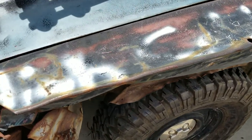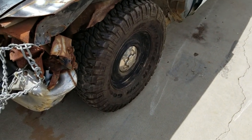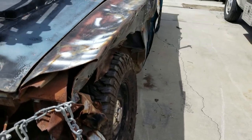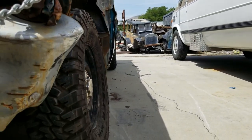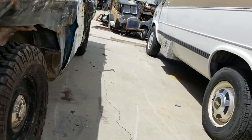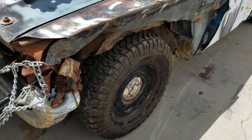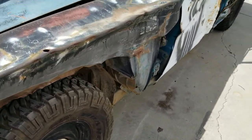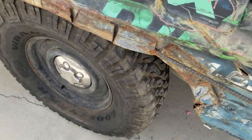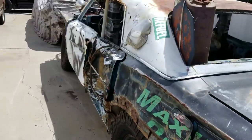I'm not gonna adjust the toe to compensate for their stupidity. I'm gonna have to cut or grind the welds and just recamber the front end so the wheels are actually level. You can see how bad they're cambered — this is stupid. If it were taller and I could get more up-travel to where they'd straighten out, I wouldn't mind a pre-runner because I do go off-road with it.